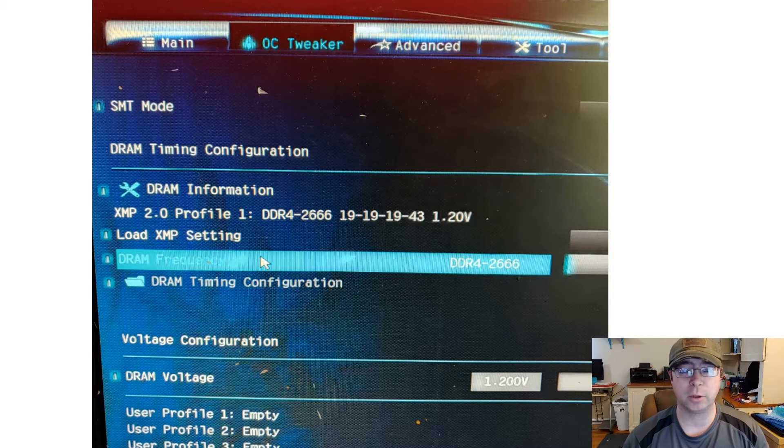I went into the BIOS to see what kind of memory she was using, just to make sure I would get the right memory to match what she had inside. If I wanted to get another eight gig stick of RAM, I would have purchased one that has the same timings, which is DDR4-2666 with a 19-19-19-43 response time and 1.2 volt usage. I was just going to buy a new pair of memory and get rid of the old one, so noting those wouldn't really be an issue. But if I was to buy a second stick of eight gigs, I would want to match those numbers exactly so that there's no issues after installation.